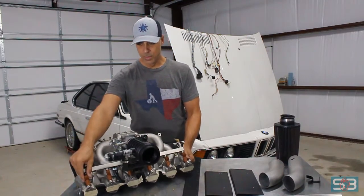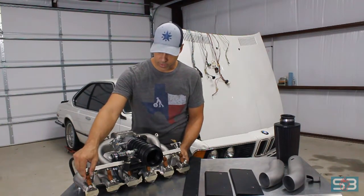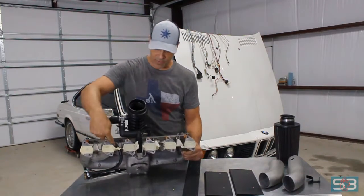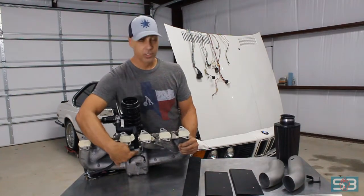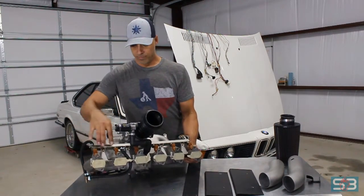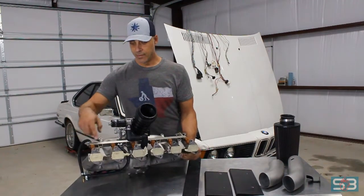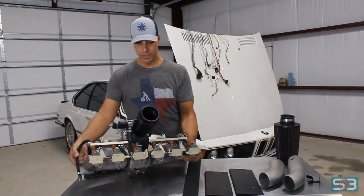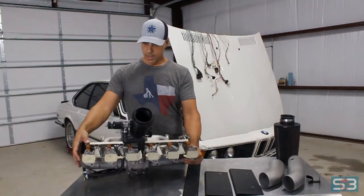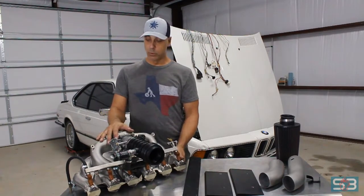The injectors I put on went on fine. There's no shimming of the fuel rail up or down. The old fat style Bosch injectors are the same height as these new higher flow injectors, so no issues there. The fuel rail itself has this extra port at the bottom that fed the extra injector for cold startup. I built a block-off plate for that extra injector hole. For this extra fuel orifice on the fuel rail, instead of trying to block it off or weld it up, I just put a T on the feed side of the fuel line — one side goes to the original feed of the fuel rail, and one goes to the extra port. So it's basically a dual feed fuel rail. That went together really well, and the throttle body is holding right up as expected. That's it for the intake — just really light fabrication stuff.